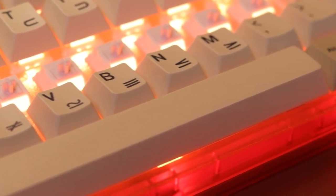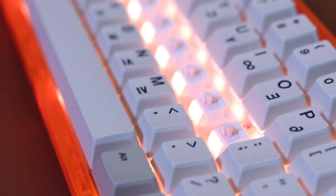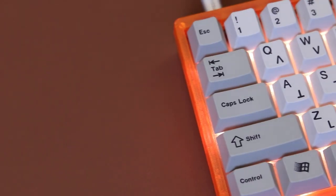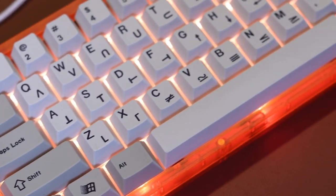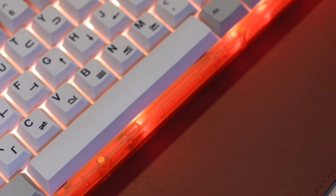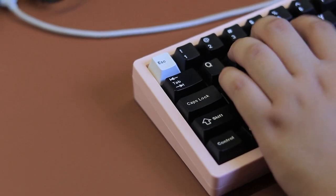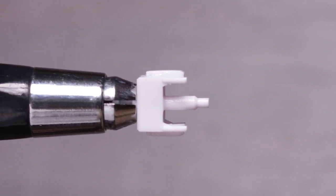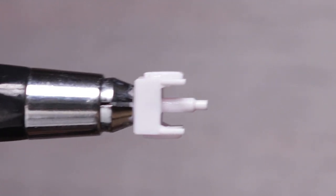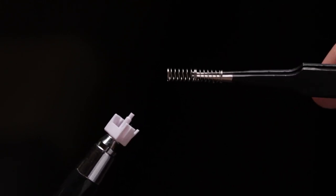So where do we go from here? If you're into the bells and whistles of the RGB diffusion, well, go for it. It should not necessarily be the deal breaker as this offers more for the typing feel beyond the lighting situation. To add, as the switch can go between deep clacks and quiet sound profile, you really need to keep in mind how this blend of POM housing and new UPE stem would perform with the choice of your keyboard and their mounting system. Lubing the spring should help you to remedy the spring ping.